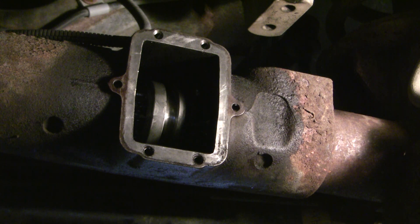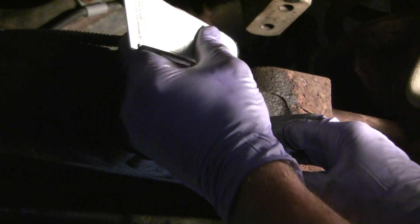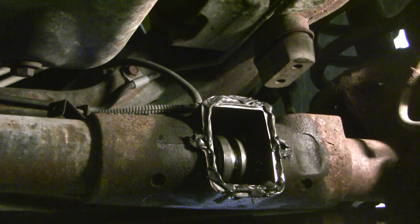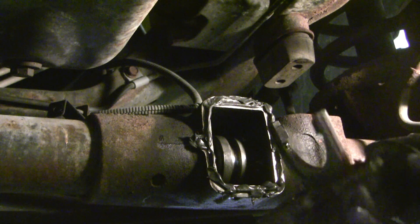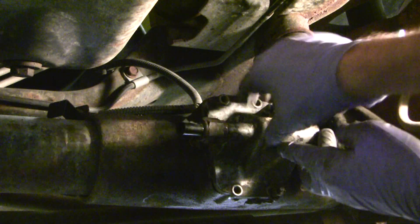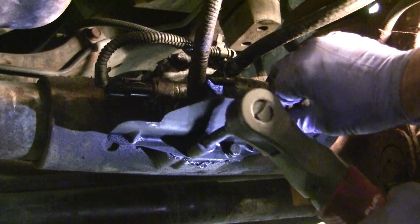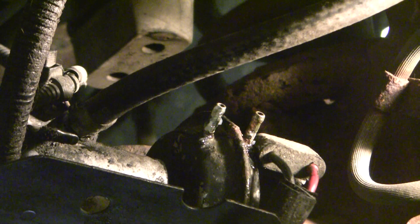Let's not overthink this problem. Rather than wait for a new gasket or make a new gasket, I'm just going to use a thick layer of RTV. I'm giving it 20 minutes to set up while doing those brakes. Now let's slide this into place — the bad one was down. We need to make sure the shift fork lines up properly. For these vacuum tubes, I'm just going to put a little silicone paste around the outside of the nipples, making sure not to get it on the inside, just to prevent air leaks. Don't need a lot.